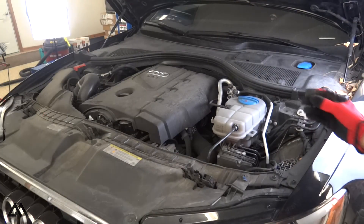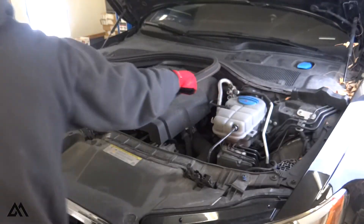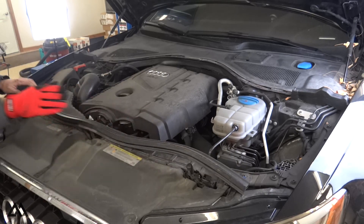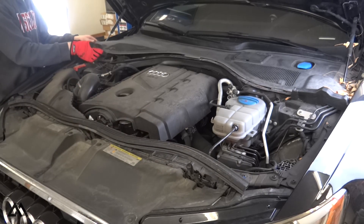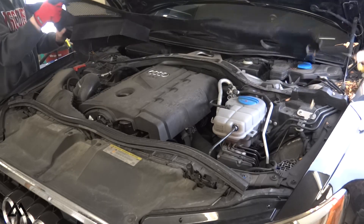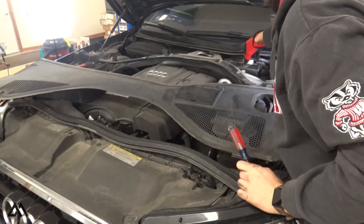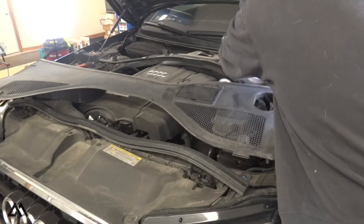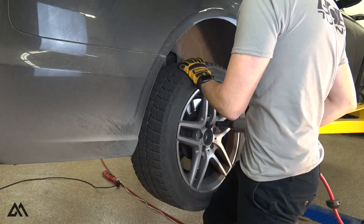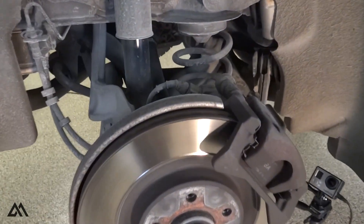we can follow our standard brake procedure. We'll want to go under the hood and open up the brake fluid reservoir. On this vehicle it's located under the rain shield — you can access the cap without removing the whole cover. However, I wanted to get paper towel around the whole opening to catch any brake fluid overflow, so I removed the weather strip and then removed the entire cover.